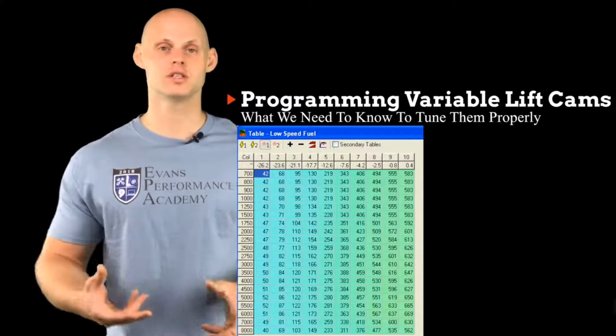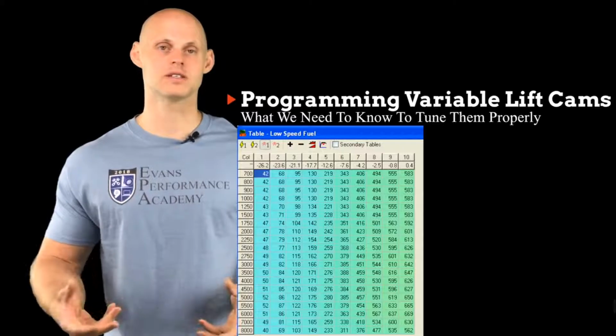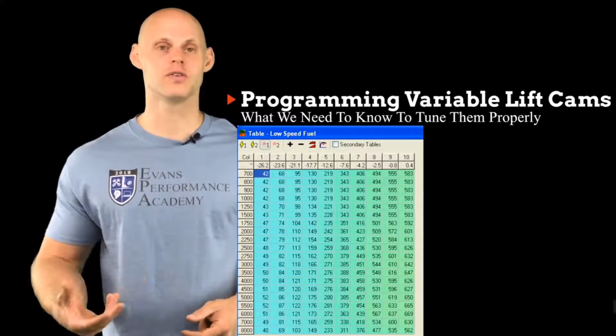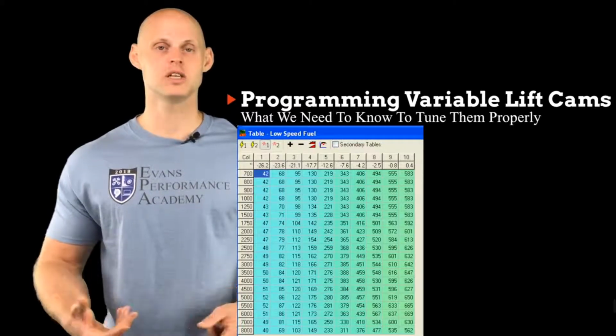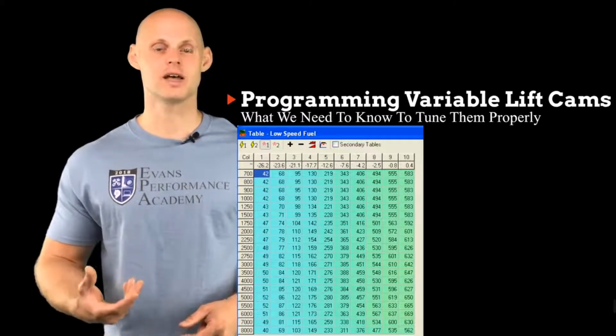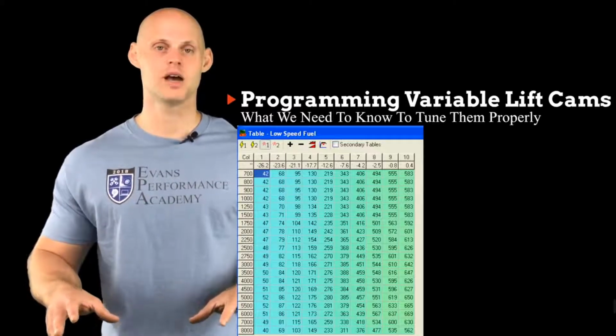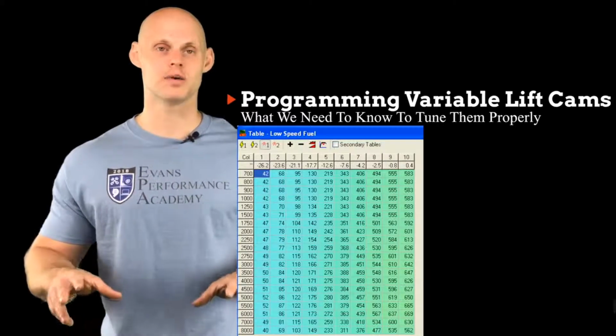Now, Honda designed the virtual side of things here based on a low and a high cam profile for the fuel and ignition timing tables. They knew that there's going to be completely different sets of air mass coming into our engine with the different cam profile, and the spark timing is going to change because our dynamic compression ratio is going to change. So they knew they needed to characterize it, and the best way to do that is to have completely separate fuel and ignition timing maps depending on which profile of the cam we're running on.